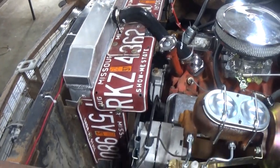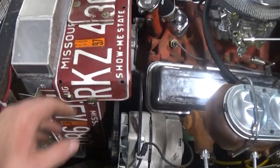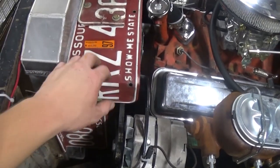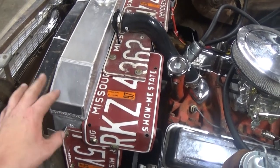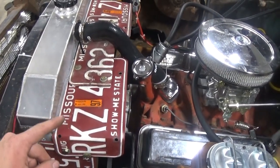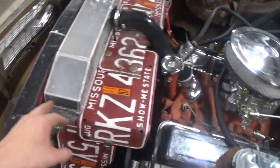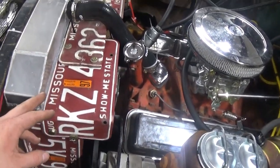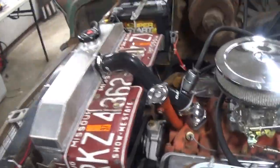This is what I've been working on. I built a fan shroud out of license plates — the really heavy duty old Missouri plates, they're really thick. I lowered the radiator one inch. That's all I was able to do before the lower radiator hose hit the crossmember. But that one inch will make a big difference, I think. I've got the shroud all wrapped up. I think it's going to do its job.